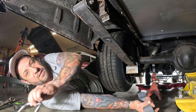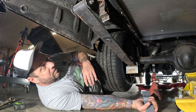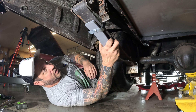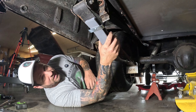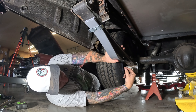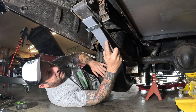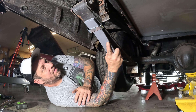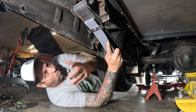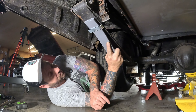I've got my spring and hardware down here, along with several tools I think I'll need. This is a leaf spring helper — not a whole lot to it. It's going to clamp up like this. There's a little bracket up top that holds it, and then you bolt a U-bolt in here and tighten it all down. You can play with the rivet position — one spot provides more help than the other. Similarly, the further you slide it back toward the shackle, it should provide more lift. We're going to put it somewhere in the middle.